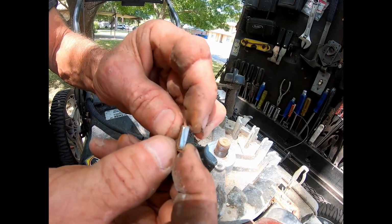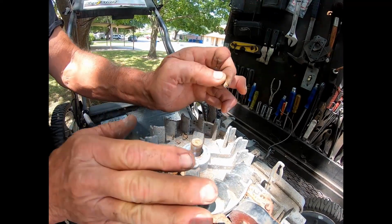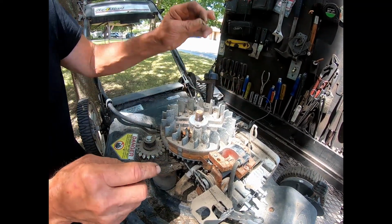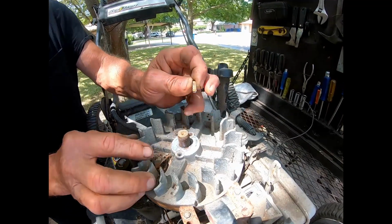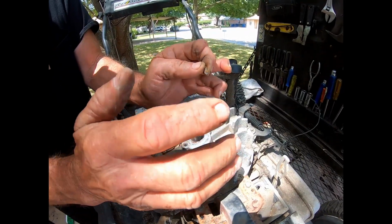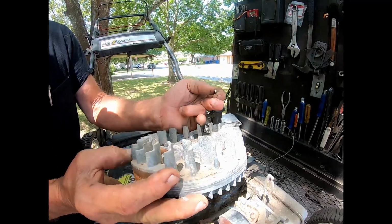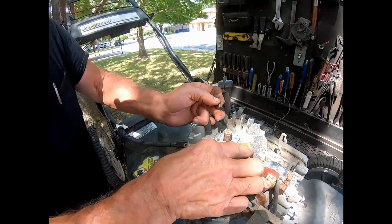It's made from soft aluminum. And you hit a stump, the engine stops. If this was hooked solidly, it would almost certainly bend and damage your crank. But they put it on, it's like a brake to dump your inertia. And so what it does, it will allow the flywheel to spin, dumping the inertia along this cone here, so that you don't cause serious damage on the engine.